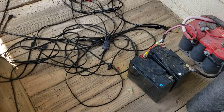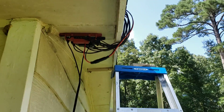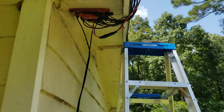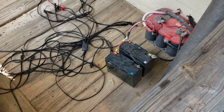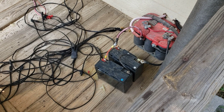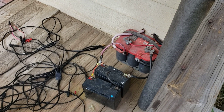This is just a simple, easy way to hook up the old kit and the new kit together. You can either pigtail them with that little SAE connector or you can cut them, twist all the positives and all the negatives together, and have just one set of wire coming down to clean things up. I hope this helps, and as always please hit that like button, share, and subscribe — it helps me bring more content to the channel. Until next time, thanks for watching.